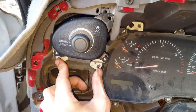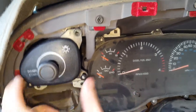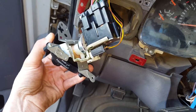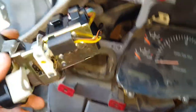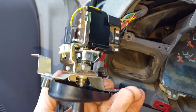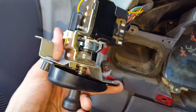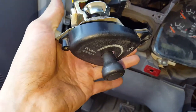Your headlight switch is going to have three screws holding it on, and then an additional two holding the faceplate on. Take that faceplate off from the back. There's a spring-loaded button on the bottom of the switch that enables you to pull the handle all the way out — it typically has two stages, one for parking and one for headlights. Pull it all the way out, hold down the spring knob, and it'll let you pull that lever all the way out.